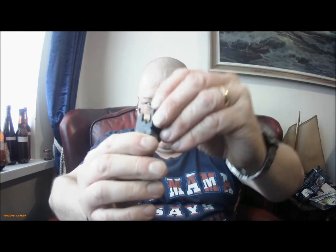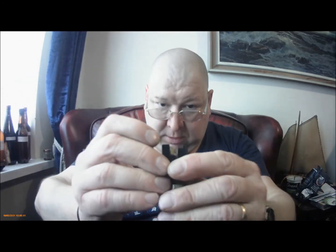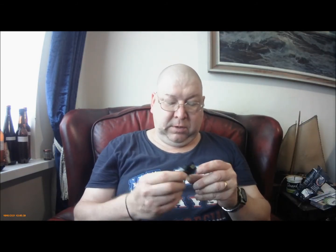I did manage to by unsoldering that tag. I don't know if you can see. Originally, like this one, there's a loop underneath the solder, which is actually the contact inside. But what I did, I desoldered it, and while the solder was still hot and wet, I bent the tab up, it broke off. So they're not serviceable.